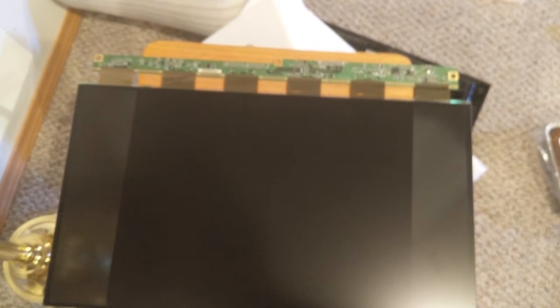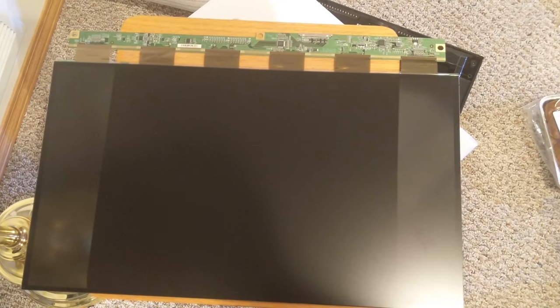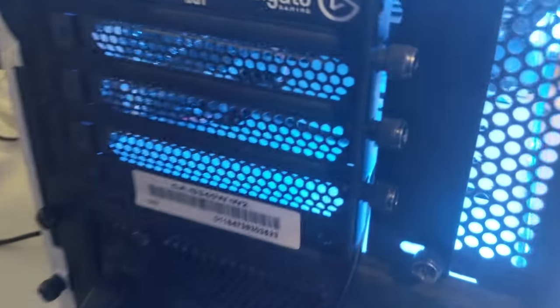If you're wondering how to adhere your screen to your tempered glass after you've spray painted the black border on there, go ahead and just buy these little adhesive dots. I picked these up at Walmart, just placed them all around the screen and it holds it real nice — I even flew with it from Wisconsin to North Carolina and it didn't move or fall. Another reason why you don't want to use another screen is look at all those ribbon cables. The screen I have for you guys just has two ribbon cables — pretty easy, pretty clean. This is just the power cable, it plugs in and runs all the way into the back where there's a little hole through the case, and then routes back up through the back and right into where it plugs in on the motherboard.